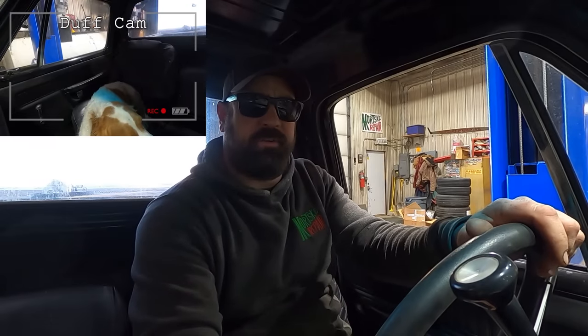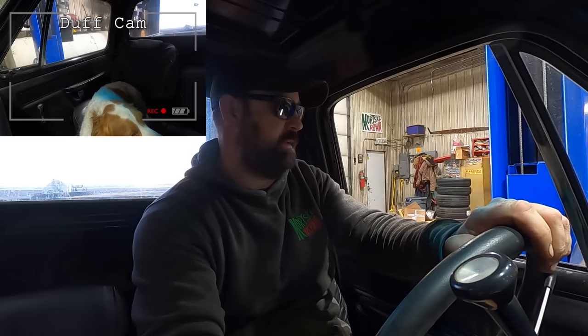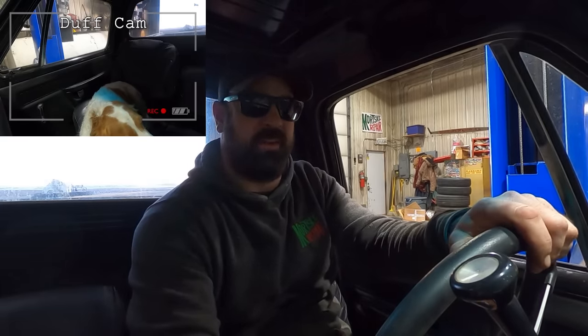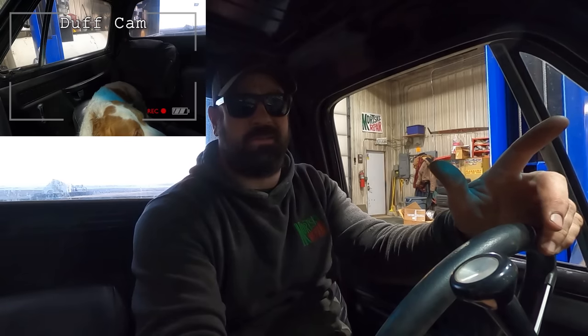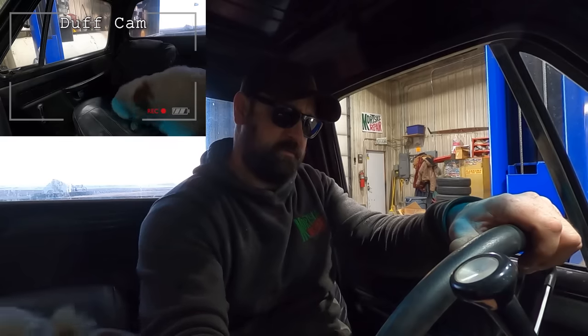All right, checked all our fluids, should be good. Rear brakes are bled. It's been a long week. Merry Christmas, everybody. I'm ready for it to be here. Just another working day for us. Ready to go for a ride for the first time on this thing, Duff? Tighten up the power steering and the alternator belts. Mopar uses an interesting design for that. Topped off the coolant.